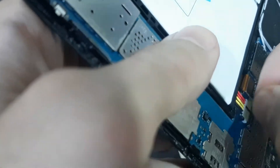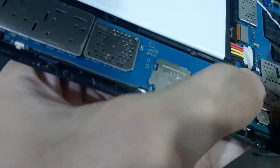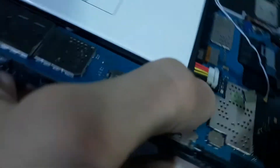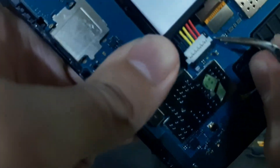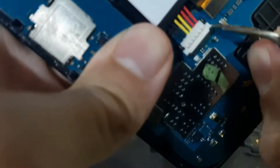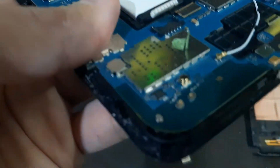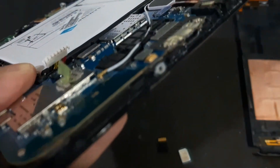Let's remove this protection for the connector of the battery. The most important thing about removing the battery is that without removing it, there will be electricity flowing — at least some electricity flowing within the electronic circuits. With water you can basically short the circuit. So we want to have almost no power within the circuits until it dries out in the rice. Now we're trying to dry it out even more, checking out the connectors — the USB and headphone jack.